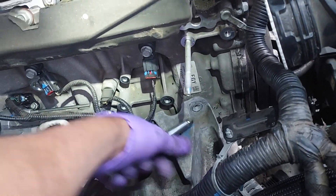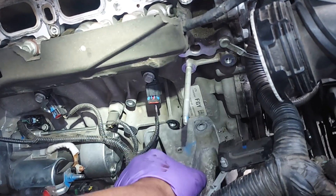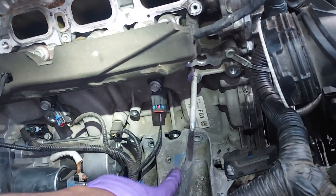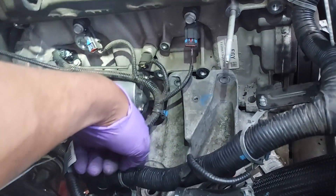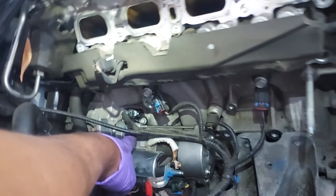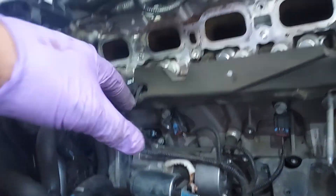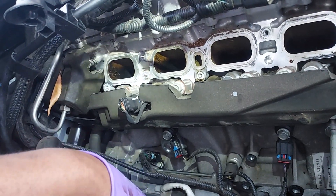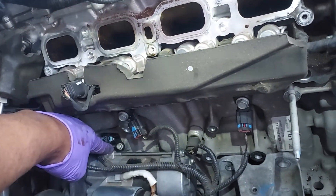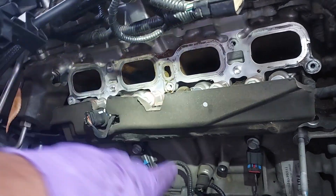The bracket for the motor mount bolts into these two holes, which means you should have room to get to that bolt without taking your motor mount off. For me, I had to do it because on my first attempt doing this crank sensor, I followed directions to take the starter off to get into this bolt — it's a pain in the neck and hard to do. So I recommend: do the intake. Come in from the top, don't mess with the starter. Leave the starter in place and you can get right to your 10 millimeter crank sensor.